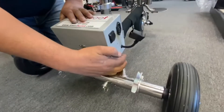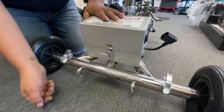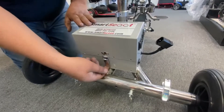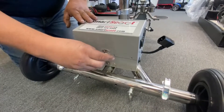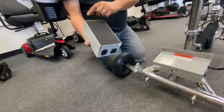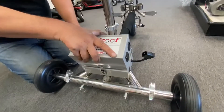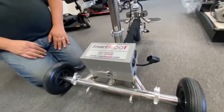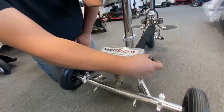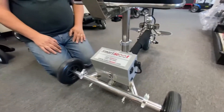There's also a switch on there that turns the scooter on and off. This is your battery release — it's just a little hook clip that goes over and holds the battery in while you're driving. To remove the battery, just release that and lift the battery off. There's a little slot that locates the battery back onto the scooter. Just slots back in, put the hook back over, secure the battery, plug it back in, switch back on, and you should have power to the scooter.